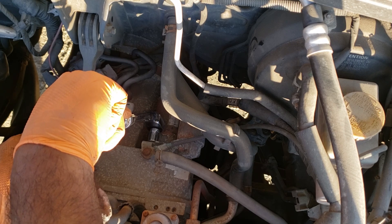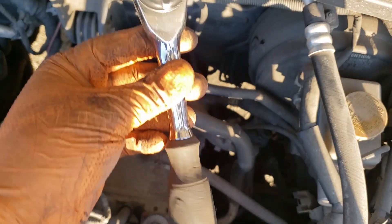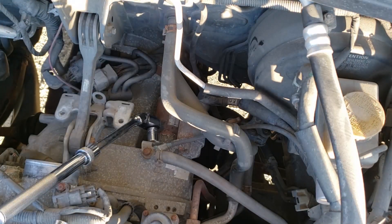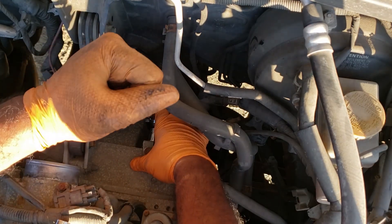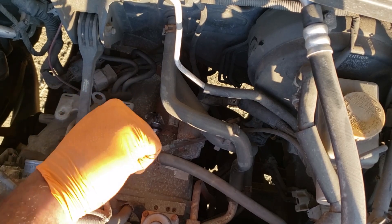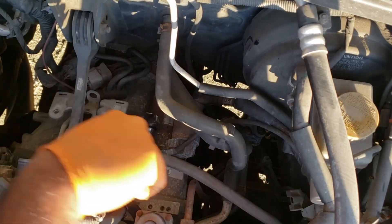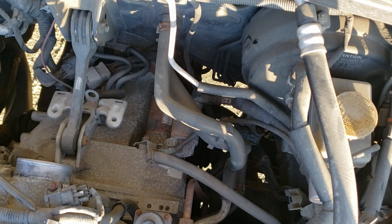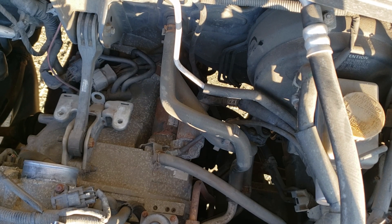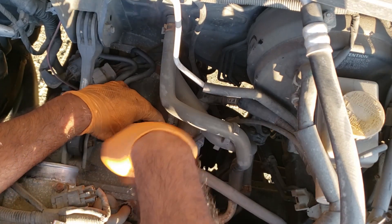Subarus are basically the same — the Subaru will have two bolts that hold the starter on. For most automatics, it's going to be a nut and a long bolt up top. If you have a manual, it's going to be two long bolts, this one being the longest of the two. On either setup, automatic or manual, this bolt can leave you in tears. When you go to crack it loose, you want to try to ascertain whether the bolt's going to break or strip. If it is, I would suggest towing the car, because if it breaks inside the block you're screwed.